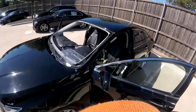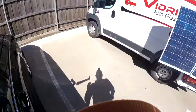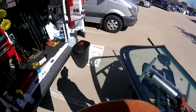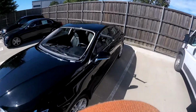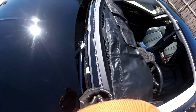Alright. Okay, so it's clean, no scratches. We already waited more than 6 minutes on this one. 10 on the primer, 3 on the activator pads, so all normal. I have to repeat this every time, every video, because I need to prove in my videos that I follow the bonding system, the chain of the bonding, all the steps the right way.